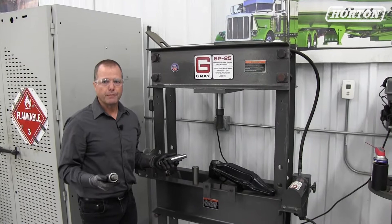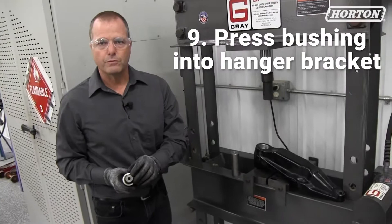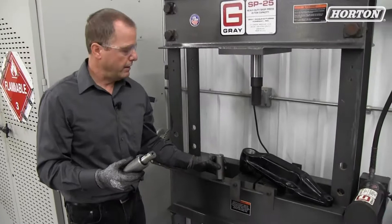In this particular kit for the rear shackle, you have one roller bushing with ribs on it and another one that is smooth. The ribbed one is going to be used for the spring eye. The smooth one is what we're going to put into this hanger bracket. It's important when installing into this hanger bracket that you pay attention to where the grease zerk is — you want the grease zerk to be on the outside. Install the assembly together and use the drive tool that you can purchase where you purchased your roller bushing kit. This particular one is matched for this so the pin fits in there nice and snug.